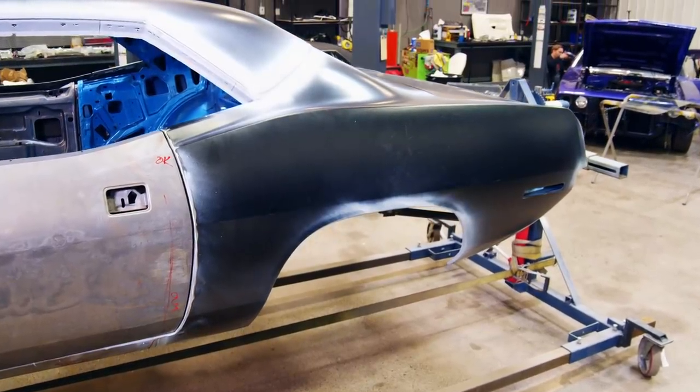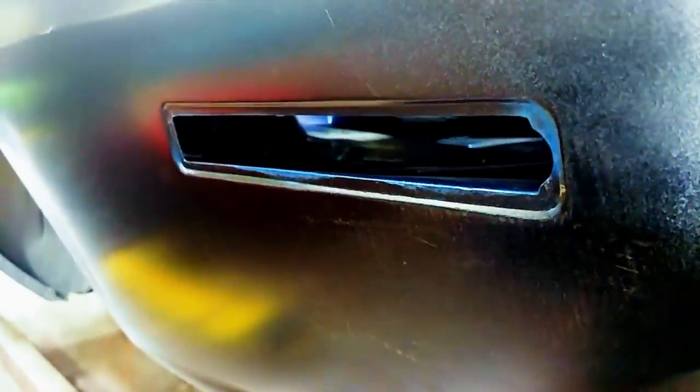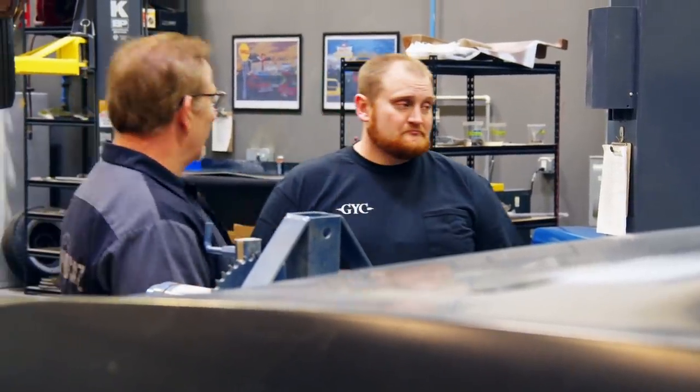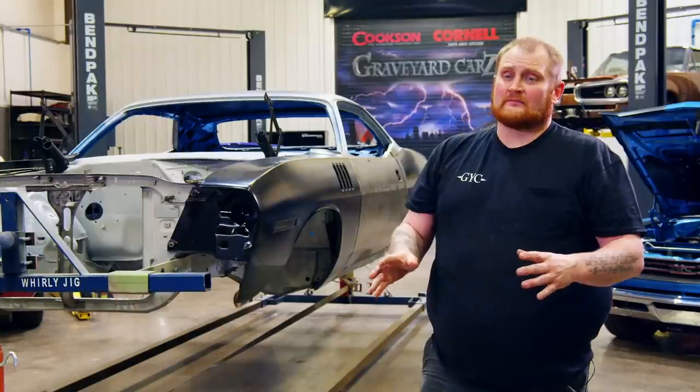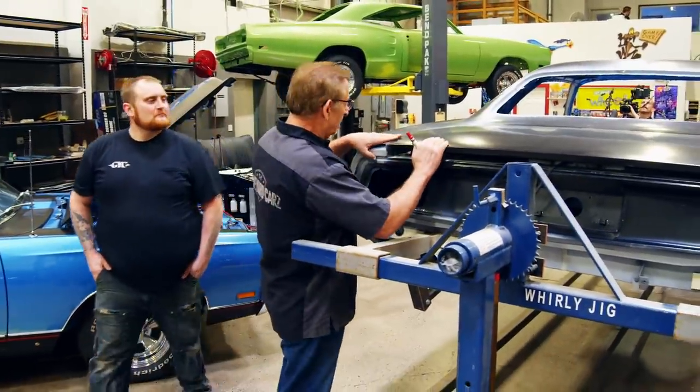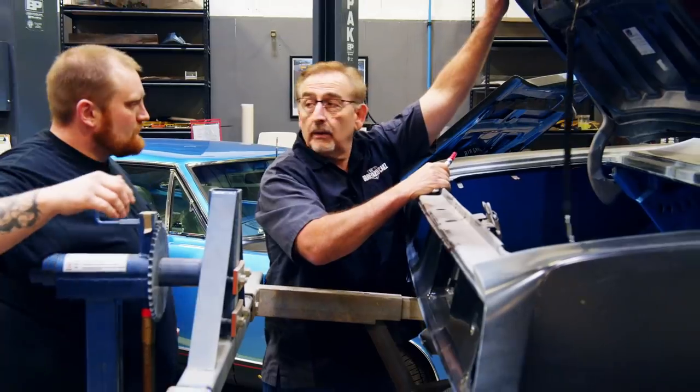Side marker area is great — a lot of times those don't fit. George is here for one reason only: to build cars and get them out the door. The fenders from Auto Metal Direct are great but they always need a little tweaking. See how close our gap is here? It starts getting wider right here — that's the fender. We're going to have to move the fender back and close this gap up a little bit, and we may need to clean the end of that rocker to give us a nicer line. Otherwise, I don't think you're going to have to do any cutting and welding. The quarters fit the wheelhouse nicely — looking down the side there's a nice plane, so we can move forward with filler and smoothing.